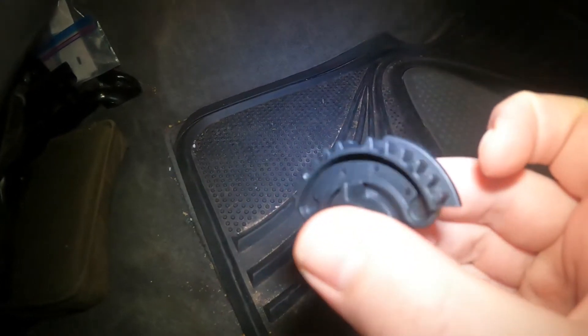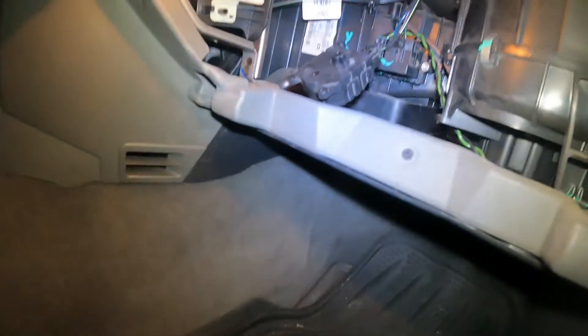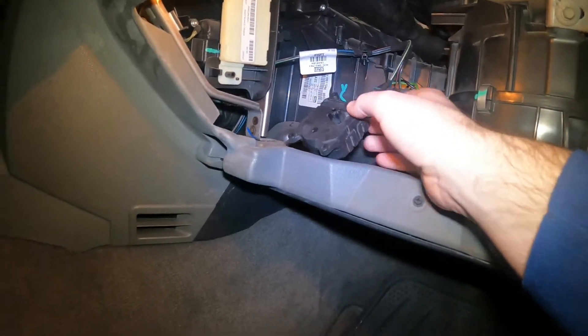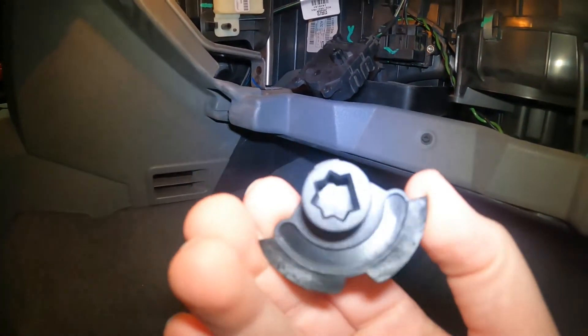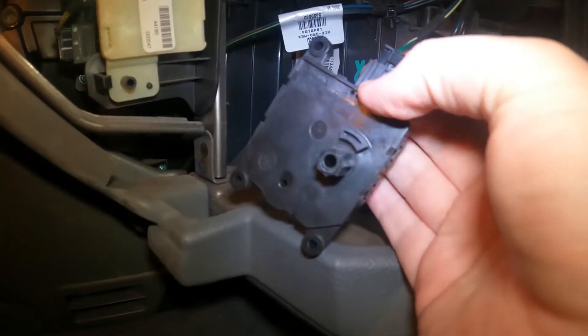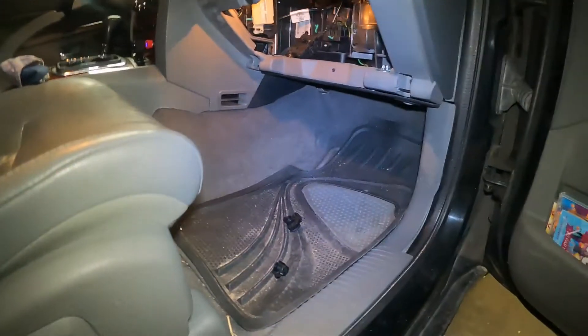This is the replacement part, with the teeth section back on. What happens is you'll hear a loud clicking noise as this motor will try and turn that gear. It's got a special recess on the back — it's keyed, which lines up with the keying on this gear, and that clicks away if it's not in properly.